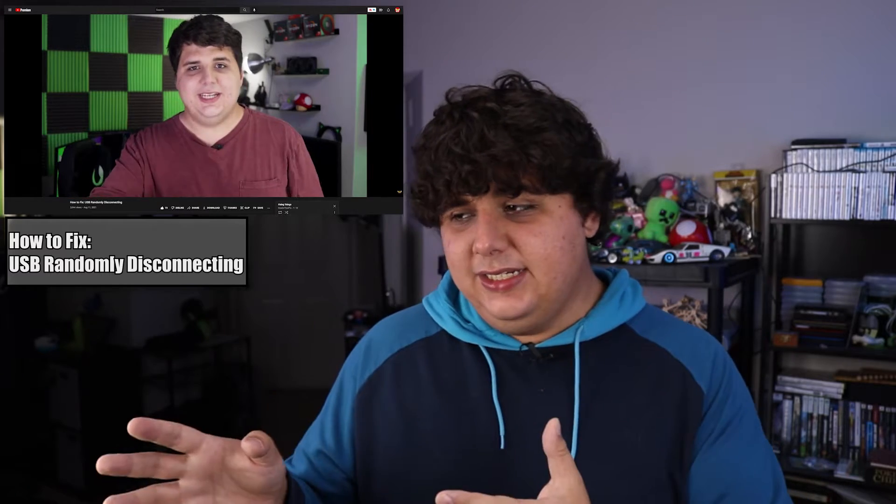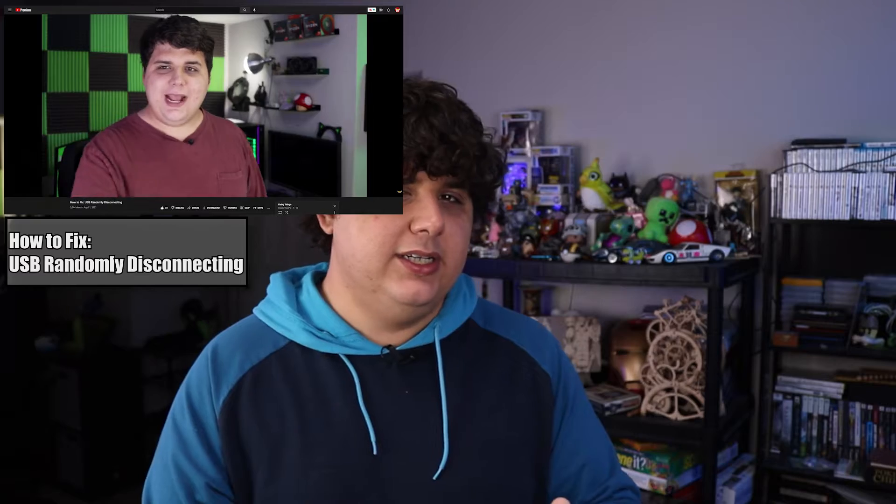My name is Wolfie and you're watching Greater Than Pi. The issue is that while my Vive trackers and my headset are plugged in, they have a tendency to actually disconnect each other. I'll lose one tracker during a recording, which I could blame on moving around like a lunatic, but the fact that it disconnects and doesn't reconnect is indicative of a USB issue. I did do a video about adding an add-in card to avoid this problem — it works with the Vive trackers, but the headset doesn't like to be plugged into that card while the Vive trackers are also plugged into it.